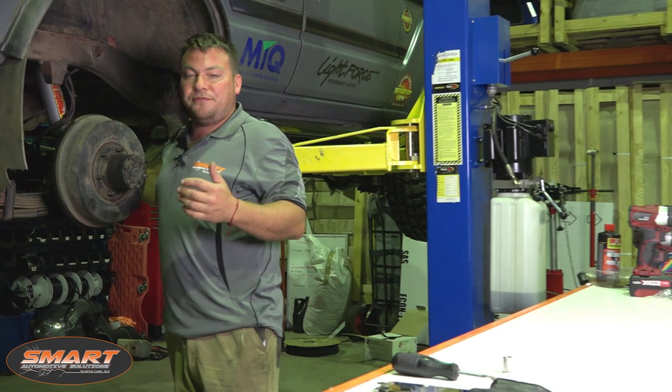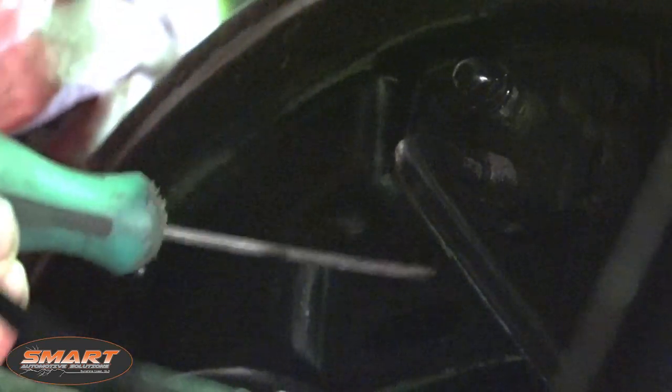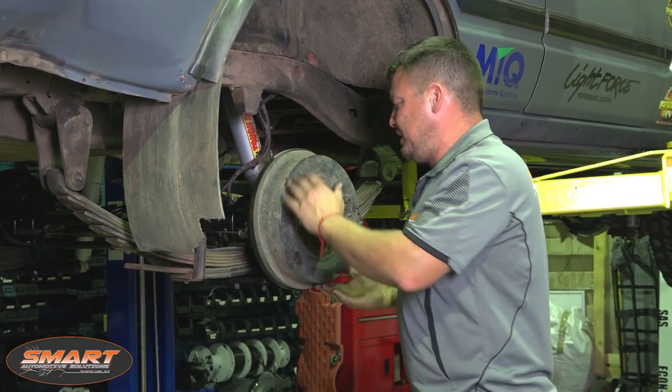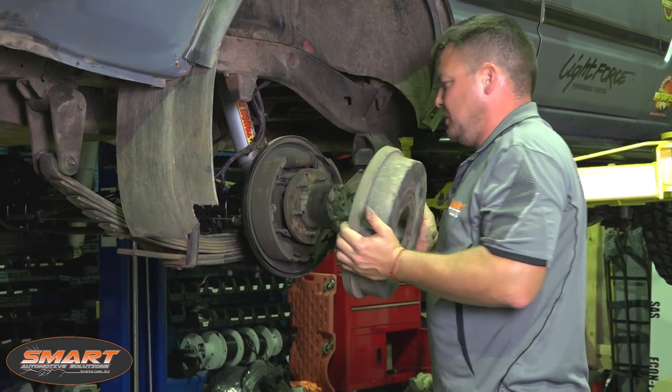In the back here, so you're not fighting against the brake shoes, it's always a good idea to let the brake shoe adjusters right off. There's no point fighting against the ratchet — use a long screwdriver just to the left-hand side of the ratchet, hold the spring back, and then you can let it off nice and easy. Once you let the adjuster off it makes life so much easier; you won't have to fight the shoes with the friction against the drum.